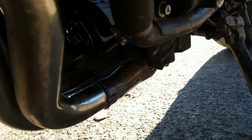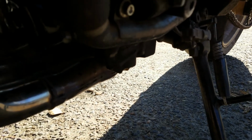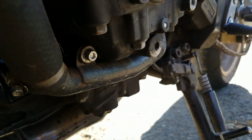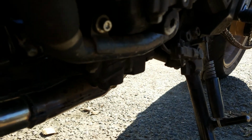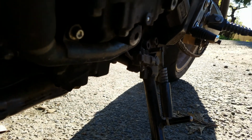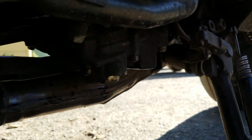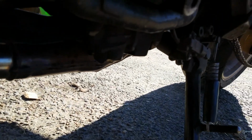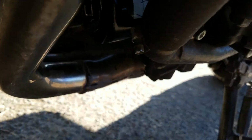Like, in the spec, I think it's about 15 foot-pounds, which at 10 foot-pounds is one finger tight. So, I mean, most people can do 5 foot-pounds with just their fingers. So you gotta remember, do it nice and lightly, otherwise you're gonna break things. And if you break that, you gotta get a whole new oil pan. If you want to do it right, you could helicoil it, but it's not gonna be as good. I can guarantee that.